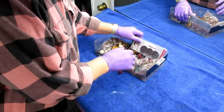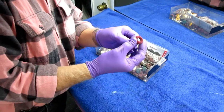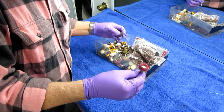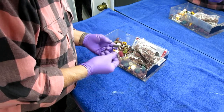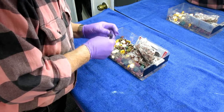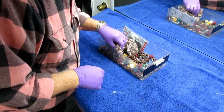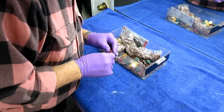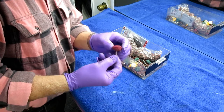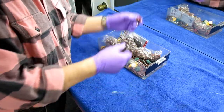One of the really good investments I made — I have this on a previous video — I went to Amazon and bought bags of sanding drums, wire brushes, and little things. These are great for removing rust. They're low quality, not like genuine Dremel things, but they'll do the job. I'm looking for the one with the roughest grit — the black was the roughest. I've used them on the RD to polish the engine. Looks like I ran out of the black ones; we'll use the red one. They don't grind in and make big scratches, they just take the material off. The downside is it's a good idea to do it outside so the dust blows away — here I'll just put an old towel down and shake it out when done.